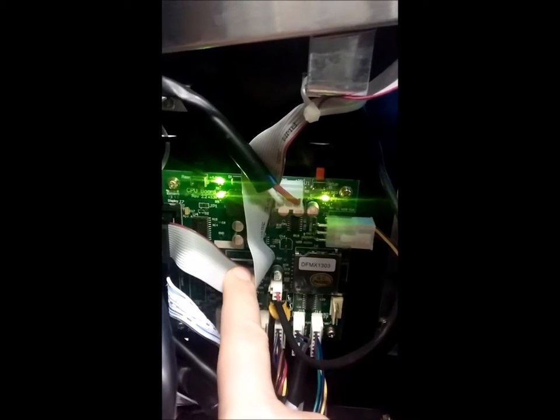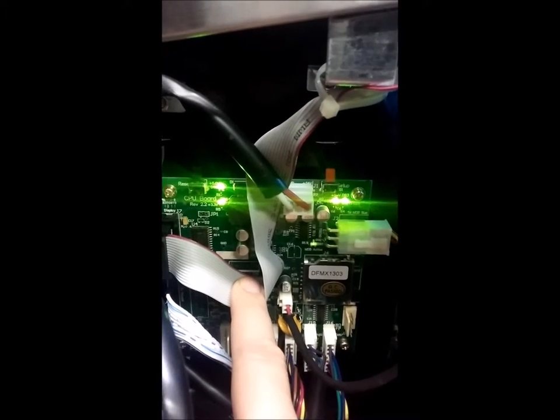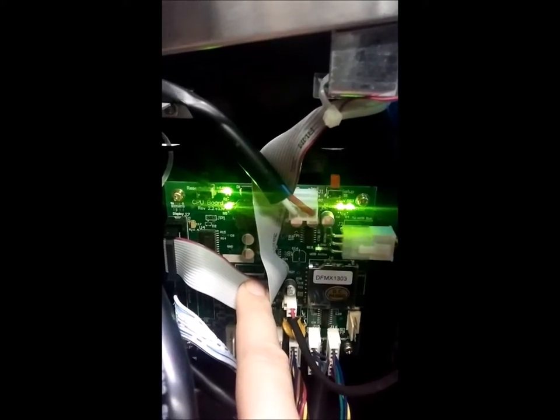The Discount Vending Store presents normal board conditions for a Fortune Resources machine. On this main circuit board, under normal conditions, you'll have five green lights — three solid and two flashing. That's what you want to see if everything is functioning properly.